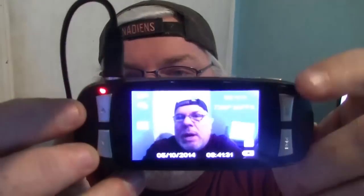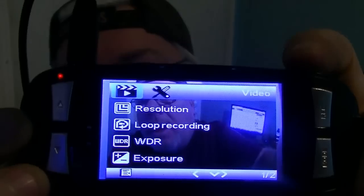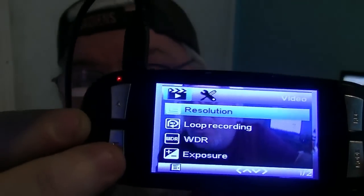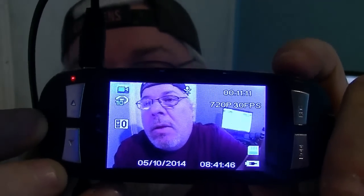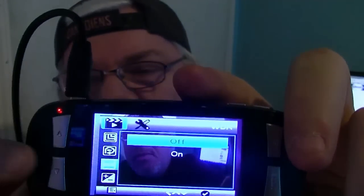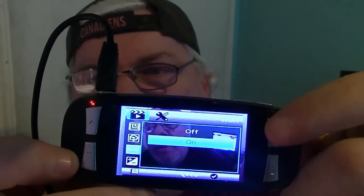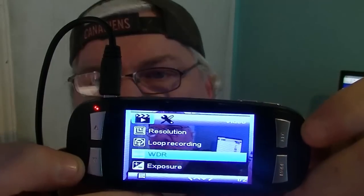I really don't know if WDR applies to these cameras or really works on them. Let's go see how to get into wide dynamic range. The camera is already stopped recording. Press this to stop recording, then go into the menu and use this button to go down to WDR, then press select. I have mine off because I wanted to see what difference it made. On these cameras I really don't think it works, or if it does, it's on all the time. Anyway, we'll select on, then turn the menu off.